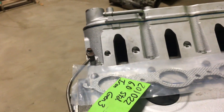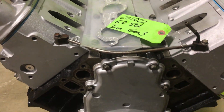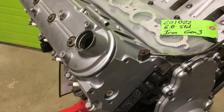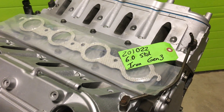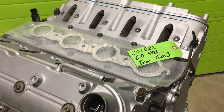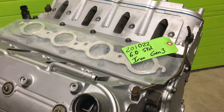We topped this one off with a VCM-21 cam — it's our knockoff of that cam with those rough specs. This engine with a good intake and some 42-pound injectors should be able to produce mid-400s. I know every time somebody sells you an engine they tell you it's good to 800 horse — this engine will not make 800 horse. This engine will make mid-400s. Nice and peppy.